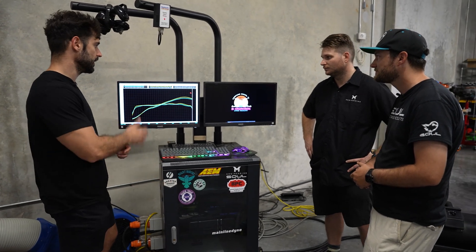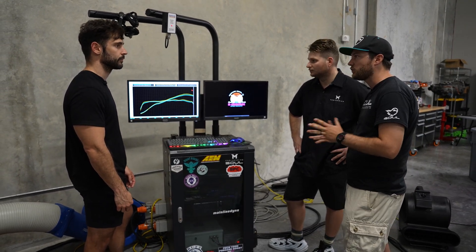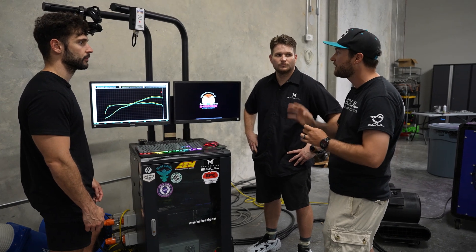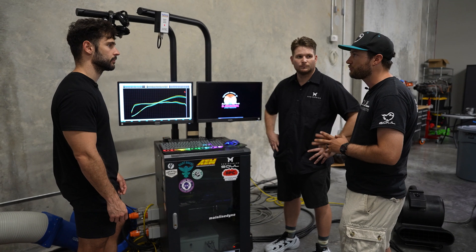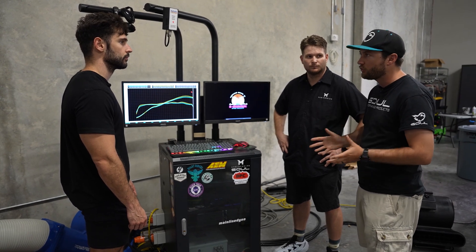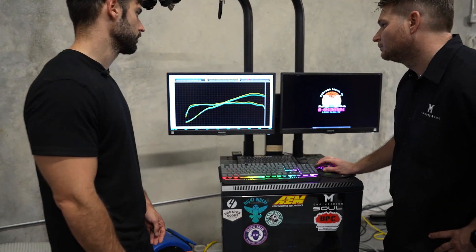Now we've got the over axle pipes in place and we've seen the tune. What's the next logical thing to make more power? The next logical step is to play with the headers on these cars. As we've seen on the 4-liter platform, the muffler replacements aren't where the power is, unlike the GT4 RS where the flow path necks down from three-inch primary to two and a quarter — a big speed bump. The standard 4-liter factory exhaust is about two and a quarter throughout, so changing the muffler isn't a big restriction point. The logical thing is to go after a header change for increased performance.